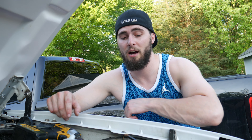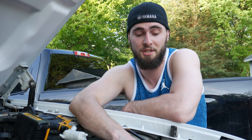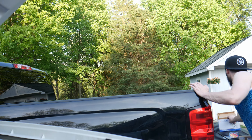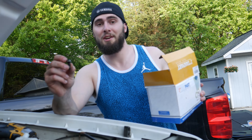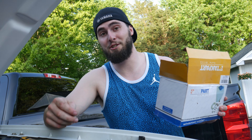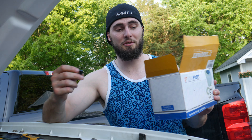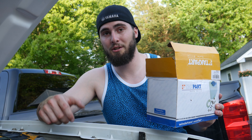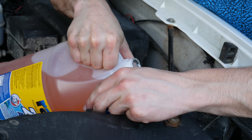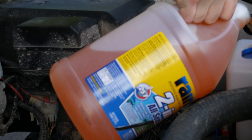This is the old pump — now we have a new tank and pump. Real simple plug and play. The great thing about this kit, which I will post in the description, is you could put it on anything. Let's say you have a golf cart with a windshield and you want windshield wiper cleaners — you can literally buy this and connect it. It comes with little nozzles. Or if the ones on your windshield wipers broke, you could add these into your hood and shoot it onto your windshield. It's a nice, cheap, easy little kit — comes with hosing and a little button controller, kind of everything you need. I just wanted this to get it out of the wheel well so I wasn't rubbing on my tire.